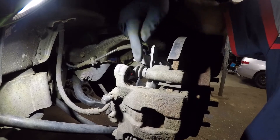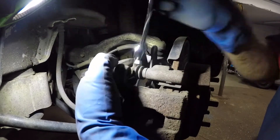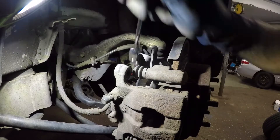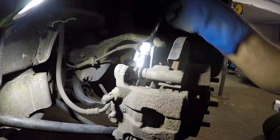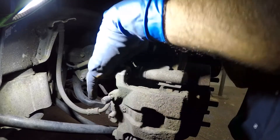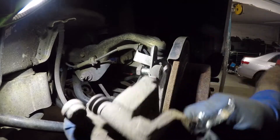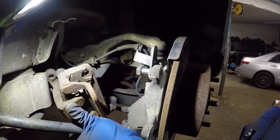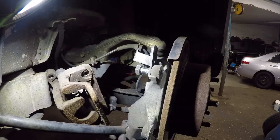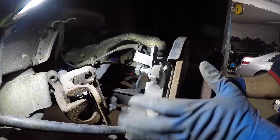Notice this thing goes through that bolt — it works like a little washer, so make sure you put that right through. That holds the ABS line. So this is the driver's side rear hub assembly. There you go, we got our caliper out — we can just let it sit right there. This bolt is corroded in there, but we got that out. Next step is we're gonna take out this disc.